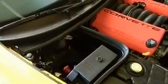So also, the reason why you have to pull the battery is because down in this little corner, that's really kind of hard to see, that's where we're going to run our amp power wire for our amp. There's already one in there, but this isn't what we're going to use. We're going to refeed a new one through that same hole down in there, using this existing wire.